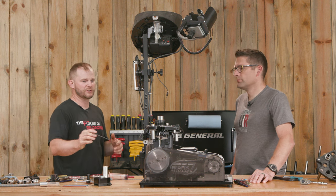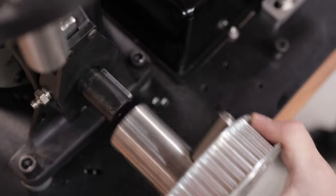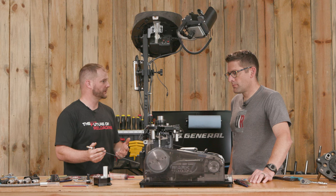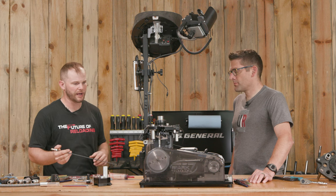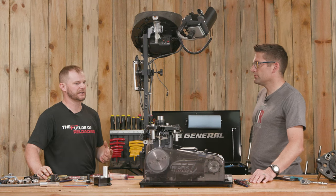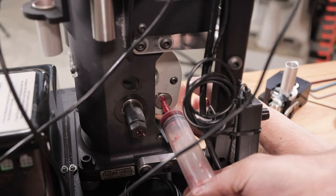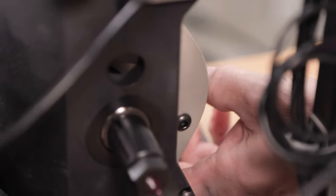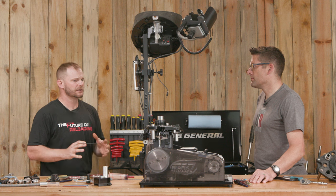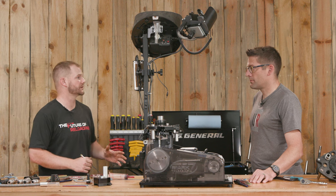When it comes to grease, we do have to pull the sprocket off on the Apex to access the drive shaft from the right-hand side. The left-hand side has the same access point and can be reached whether the machines are together or not. Keep your driveline tight — the drive shaft goes side to side, and there are two set screws that secure your crank to the driveshaft. Check those whenever you're doing grease. When the machine is apart or you're in maintenance mode, check the set screws. It's that simple — you're going to prevent rubbing and premature wear to the important parts of your machine.